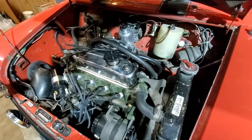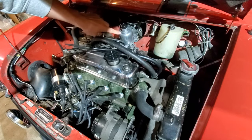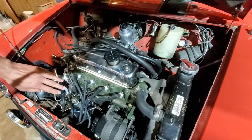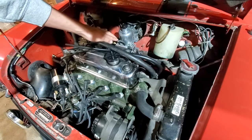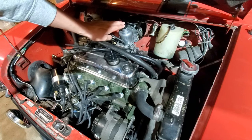Well, it's the next morning, and I've finished doing the tuning, so custom AEM needle with 530 motor oil in the dash pot, obviously fully rebuilt, and adjusted timing, so all this has been optimized. Idle is about 15 to 1 air fuel ratio, or lambda 1.01 or something, so very efficient at idle.